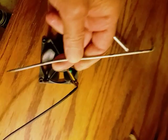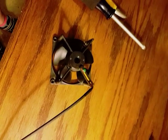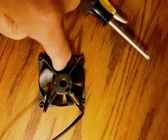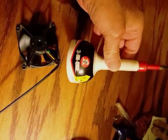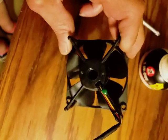What I did is I just got a little tool here — you can use a dental pick, a clothes hanger wire, or something similar. You just get down in there and push the little clip back down a little bit. It just clamps onto the shaft, so you push it down a little bit. I added a few drops of three-in-one oil and put everything back together.